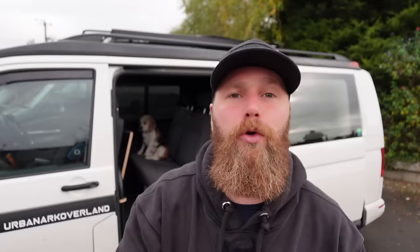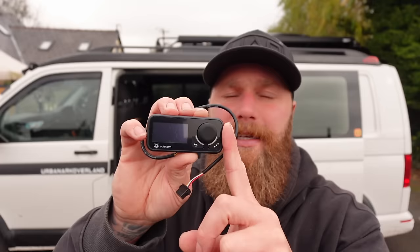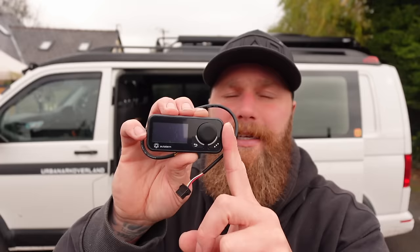The installation is 99.9 percent complete but there is still time to mess this up. If you mount the comfort controller in the incorrect location, your system will cut out long before your van gets to its desired temperature. The short 1.5 metre data cable may encourage you to install it on the edge of your seat box right near the heat output - don't do that. Make sure the comfort controller is located in a position not directly affected by the heat output. Finally, for maintenance: run the unit once a month for 30 minutes on full power.